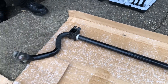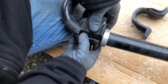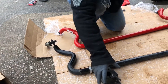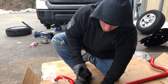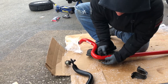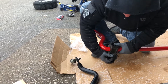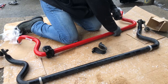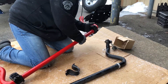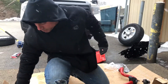There's the old unit, there's the new unit — it's going to go in in a second. To get these mounting brackets off, all you're going to do is push down on the bracket, pull that off, and then the rubber boot comes off. You're going to take this and transfer it right onto the new unit. The splits were towards the front, so put it on the same way it came off — put the rubber boot on, then put the bracket on. Same thing with the other side — split towards the front, then put the bracket back on.